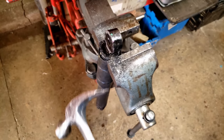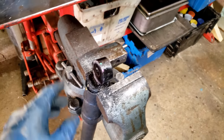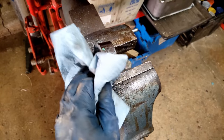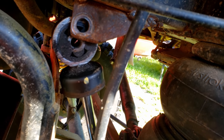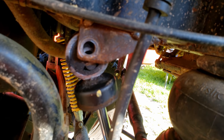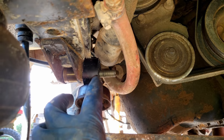Of course, I could have just bought new ones instead of getting junkyard shocked, but then that wouldn't follow the whole genuine redneck parts theme now, would it? Let's see if this fits now. Oh, you know what? This ain't gonna work, is it? Yeah, that bushing's too tall. How about that instead? Put a spacer in here and put the shock on the outside.